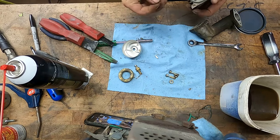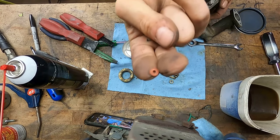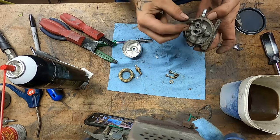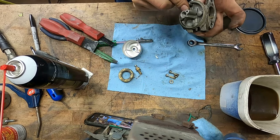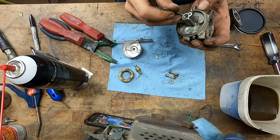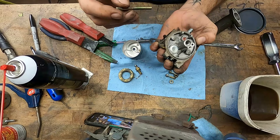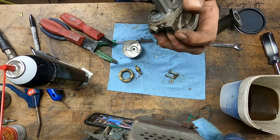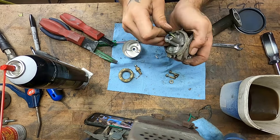The long and the short of it is, it's pretty hard to mess up putting a seat in. Put the groove side down. Get it in your hole there. Get any kind of ramrod you can find. Some people like to use a drill bit. There's a broken screw. It's about the right size. See it seated like that. Groove down. And just push it down. There's nothing to it.